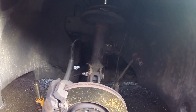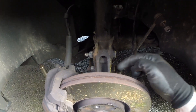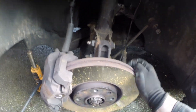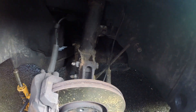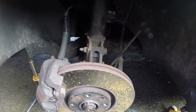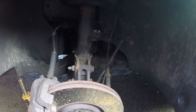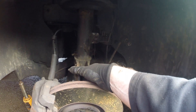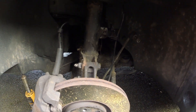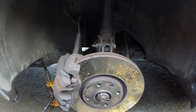It's the next day — rain stopped play and I had other things to do. On the nearside, Tess has even marked it with yellow marking stuff and you can see that gap in there; if you move it about you can feel it. I managed to get the drop link out without too much trouble because I'd put white grease on it when I'd changed them. I've loosened the top nut, just got to take these bolts out and the strut will come out. When I put this back together it's going to get some thread lock on it. Now I've got it all buttoned up — if you feel that, there's no movement at all. It's done up and there's Loctite on the thread, so that's not going anywhere.